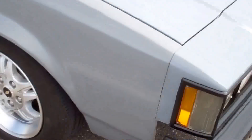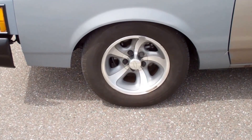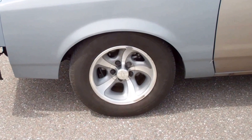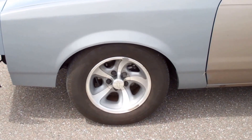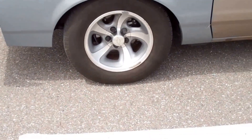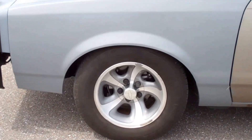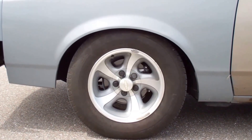The reason I don't have all four of them down right now is that this is a lowered car. When you drop a car, your turning radius becomes big. Right now the U-turn on this car takes about two acres. This is a 15x7 wheel; the nice ones are 16x8, so that's going to be a lot more wheel and tire up inside that wheel well. So over the next couple of months I'm deciding whether I can live with that huge turning radius or if I'm going to have to put another inch back in this car, which would really bug me because I like that lowered look a lot.